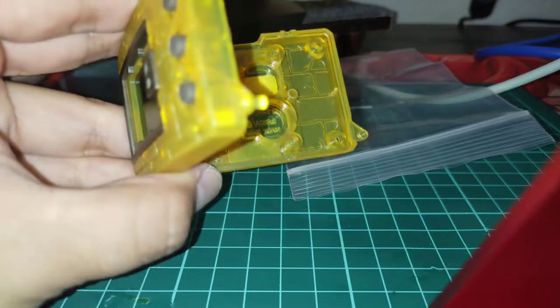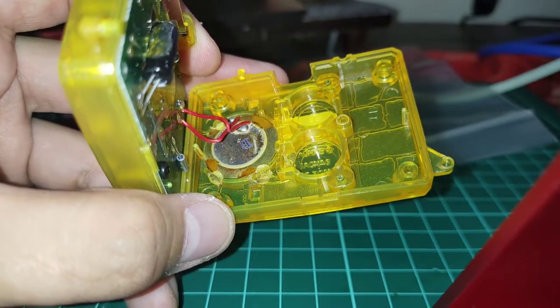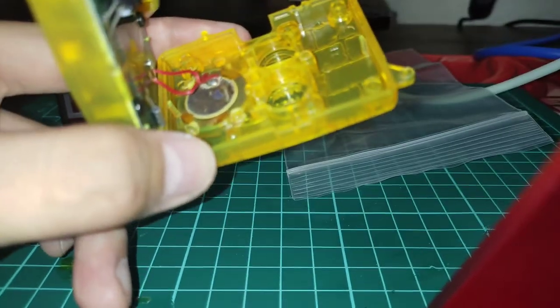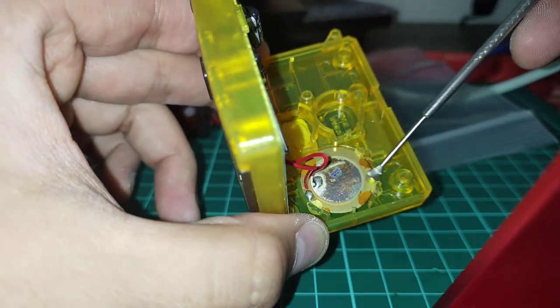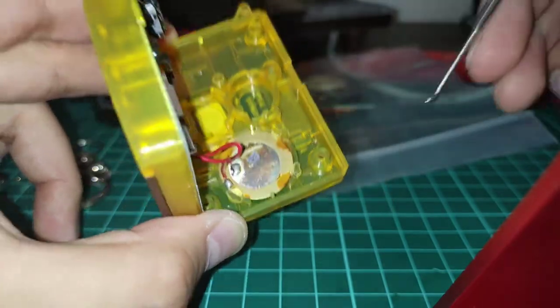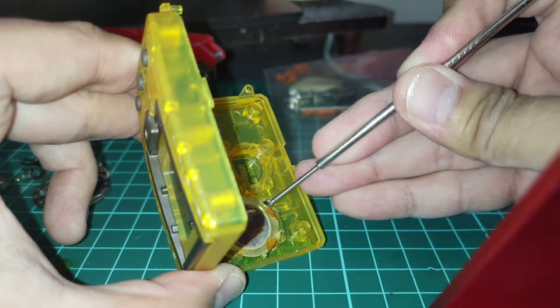Since I'll be doing an entire board swap, I'm going to remove the battery contacts and pry off the speaker. I kind of want to save this board since it's still a good version 1 board, to replace my other version 1s in case they go bad. Being very careful not to pull off the wires, I'd use some kind of pick to pry at it. The speaker is usually melted in place at about 3 or 4 points. I'll be using an ear pick — don't worry, I cleaned and sanitized it — to kind of pry the melted plastic off.